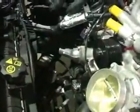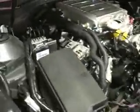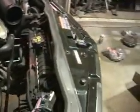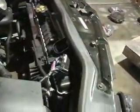But you can see there's still quite a bit of room in the engine room, so we've got to do the heat exchanger for the intercooler, and we've got to get the oil tank in there, but we've already drawn up some designs, and Cobra's working, making us a custom oil tank that we'll have just for the Camaros. But notice, too, how much radiator GM has put in front of this. So if you look, there's a lot of radiator that drops below the bumper area, so the bumper is covering up part of the radiator, but it hangs down as low as the bumper. So there's quite a bit of radiator, so we feel like the stock radiator will take care of it.